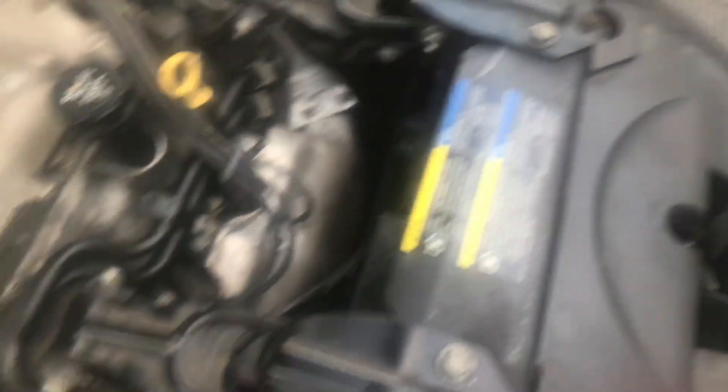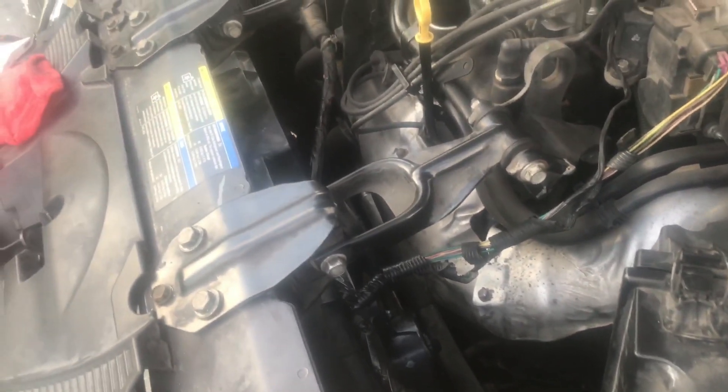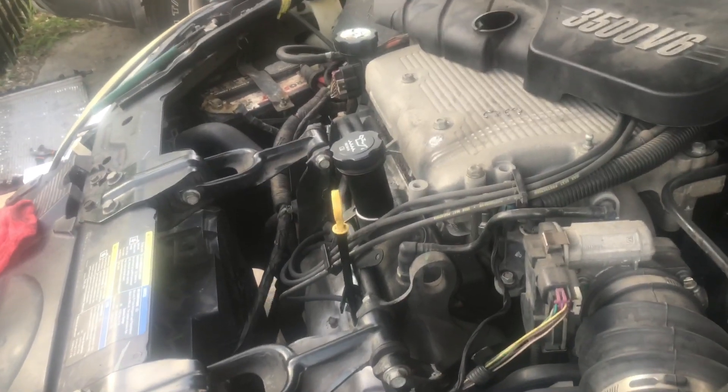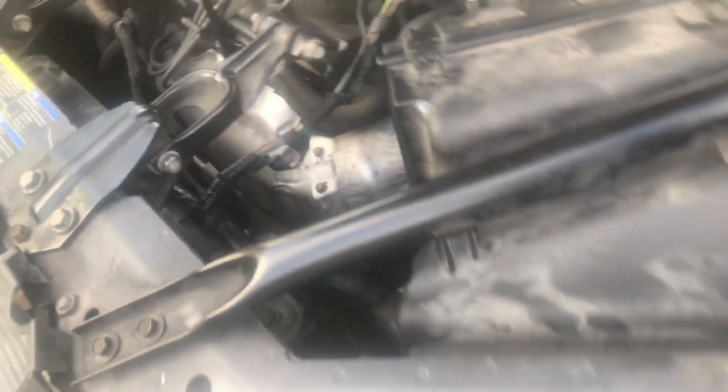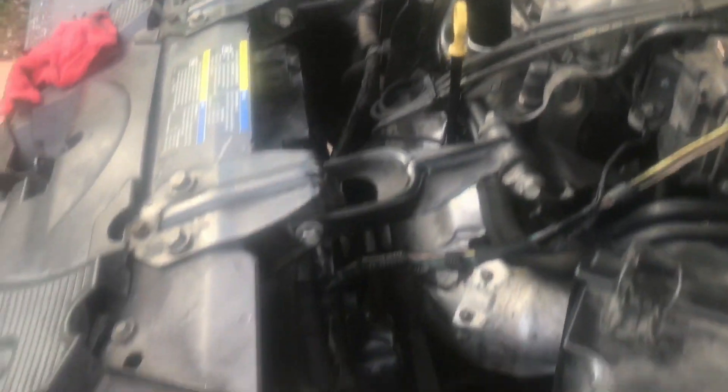In reverse order, plug up all the plugs from the radiator to the fan, screw all the screws tight, and there you have it — new radiator put back on. That's how you put on the radiator for a 2005 to 2009 Chevy Impala. The hardest part of doing this was taking the radiator from the condenser; other than that, everything else should be easy for you. Hope you liked this video — like or subscribe, thank you for watching.